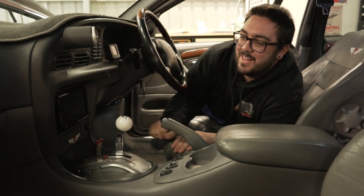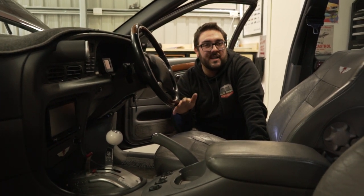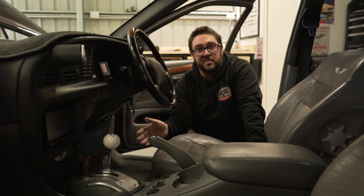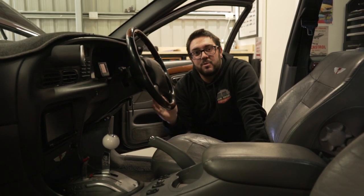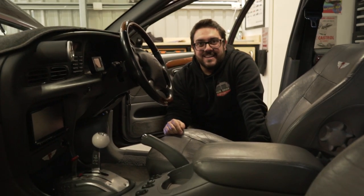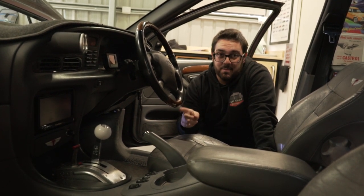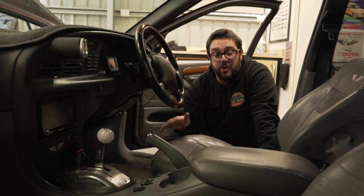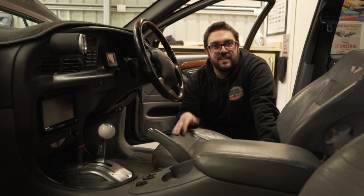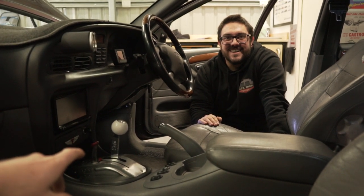The whole reason for going full manual is because these autos go into limp mode over a certain RPM or stall speed — it just jumps into third gear. This car has actually done it to me. It's only got a small stall converter in it, which will go larger in the future, and launching the car a couple of times it's jumped into third. I called up Shift Kits Australia and they said the full manual will ditch the limp mode, cut it out completely, so no more limp mode. It'll have full line pressure all the time and bang gears instantly — more reliable and safer. That's why we bothered putting a B&M shifter in.